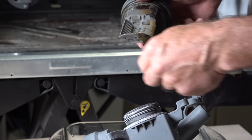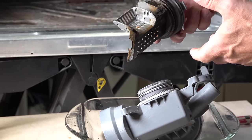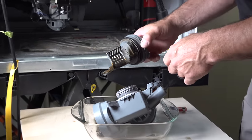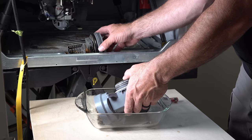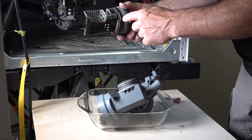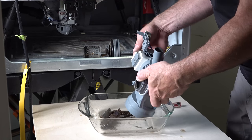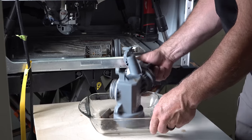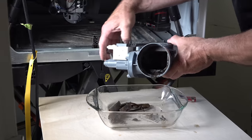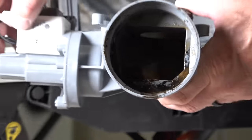There's still something stuck in there and it's pretty gross. Once you dump it out and get all the debris out, just take the basket and clean it up with a toothbrush and some water and vinegar. It wouldn't be a bad idea to put a bit of Vaseline or something on that O-ring to lube it up before you put it back in. You might want to take your toothbrush in there too and clean up the housing.